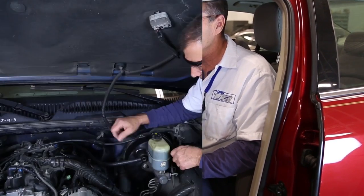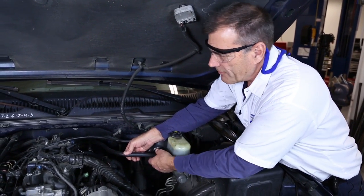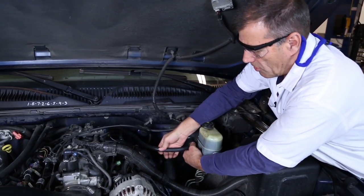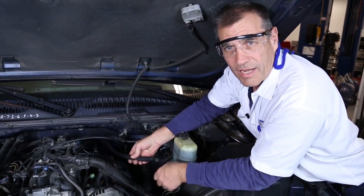And that's it. If we do suspect our brake booster is causing our hard brake pedal, a couple of checks that we can make: definitely inspect the vacuum hose going to the intake manifold. We can also remove the check valve and listen for a hiss. In this case, we did have our supply of vacuum.